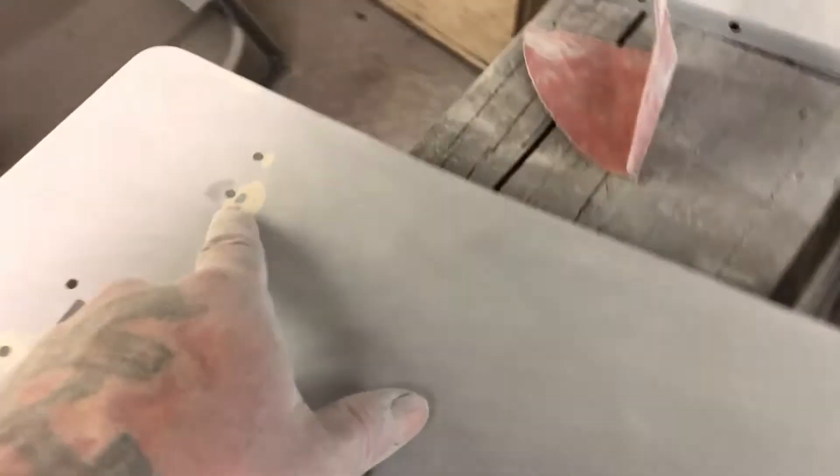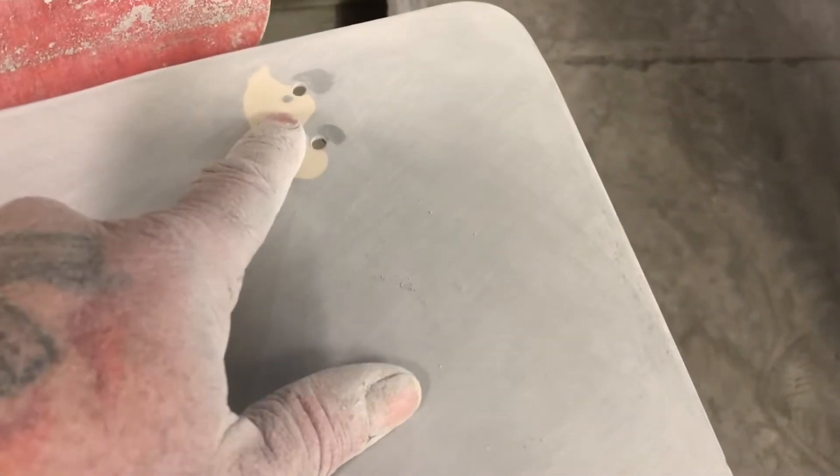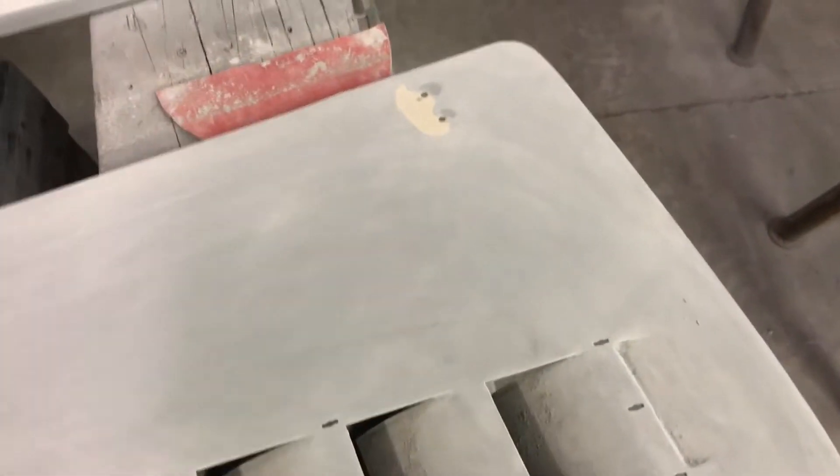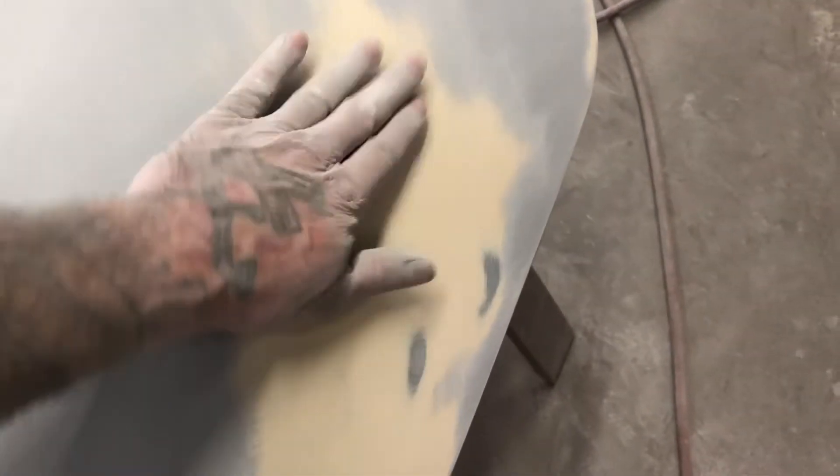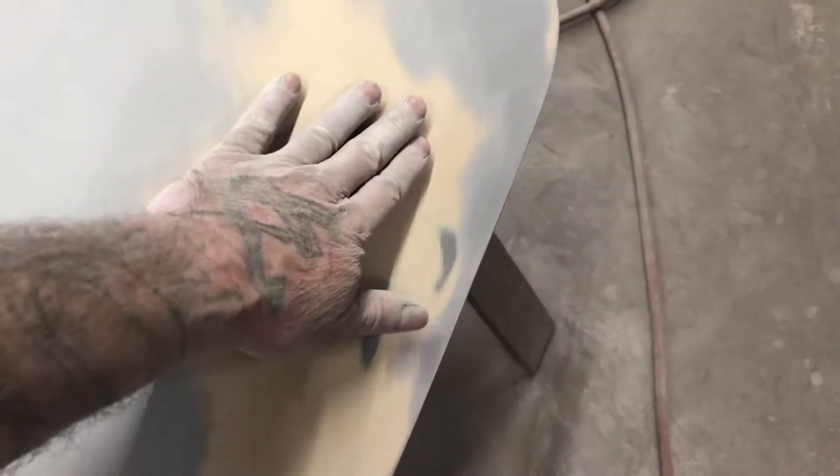Until small spots like this don't show up. See the light spot right there? Those are low spots. But these are where the hood latches go, so it's not a big deal. The primer will fill this in. And the yellow that you're looking at — we do the yellow one underneath, the yellow primer, so that when you're block sanding, if you find any spots that you go through, you want to stop. That way you don't go to bare metal. Because you can just keep on sanding until you don't know where you're at. You see all the yellow — that's just primer, a different color. Same kind of primer but a different color, just so when you're sanding through, you don't keep going until you hit bare metal.